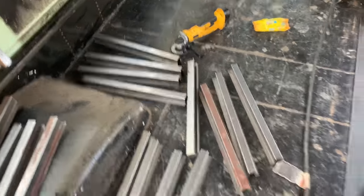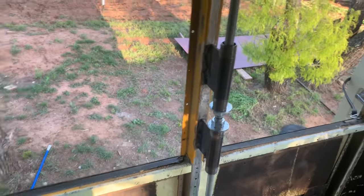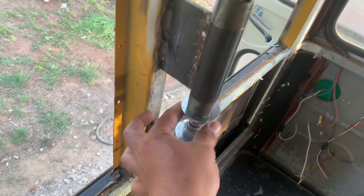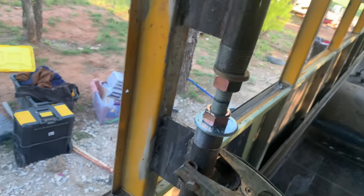We've got all the hat channel laid out here — these have all been cut to 24 inches and we've got our bracket system welded in place. Anybody who's seen a YouTube video on how a roof raise works: we're going to cut in between here, then use bolts and washers to push up this threaded rod, and that's going to help us lift the roof up. Once there's a big gap, we're going to fill that gap in with all these pieces of metal.